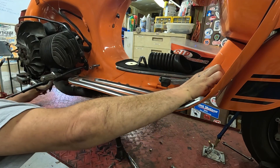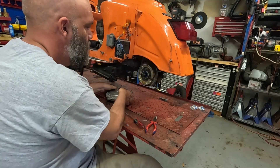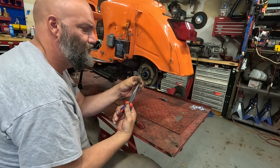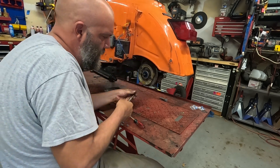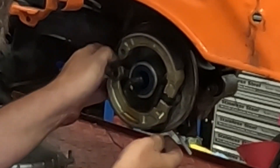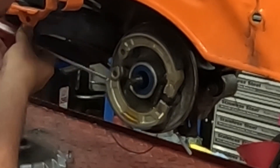You can just slide it up in there for now. Next, we're going to remove the hub and the rear brake pads. Be mindful when removing the little keeper clips on those pads as they can go flying and get bent easily — they're just made of thin metal. I always just replace these because they're super cheap. Now I rotate the brake arm so that I can slide the pads onto the end of the brake arm shaft, still keeping spring tension.